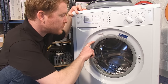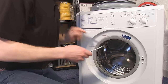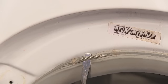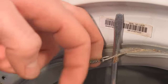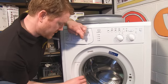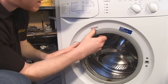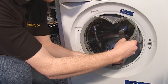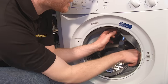To start, you need to remove the outer retaining band, and you can do that by using a flat-headed screwdriver. Once the retaining band is off, massage the door seal away from the lip all the way around, and then push it inside the drum.